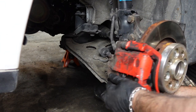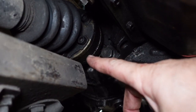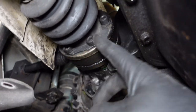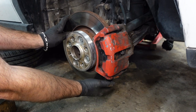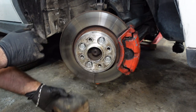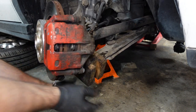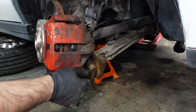The longer drive shaft is more awkward. First, remove the resonating mount or weight — that's straightforward. Now you can see the next six bolts clearly. On this side again, I've removed the lower ball joint three bolts and turned it full lock. You'll need a block of wood to put between the hub, ball joint, and the wishbone so you can pull it away, then slide it out and wedge the block in there. This pulls the drive shaft away so it won't get in the way for the remaining work.